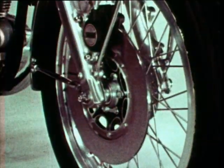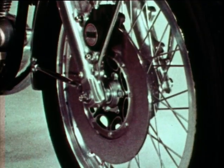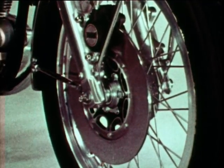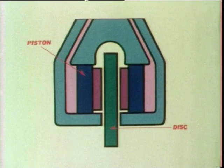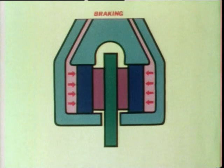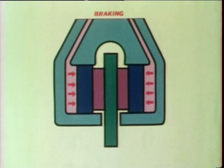Unlike the brake drum, the brake disc is exposed, but its performance is not adversely affected by water or dirt. That is, the disc brake guarantees stable performance even in rain. The disc brake was originally developed for racing cars featuring maintenance-free construction. In the case of the drum brake, when the brake shoes and drum are worn, brake lever play increases accordingly, requiring adjustment. But the disc brake is self-adjusting.